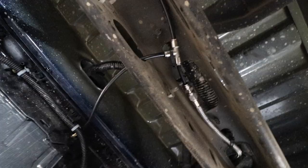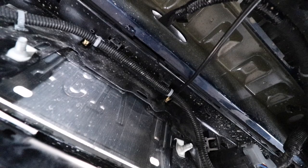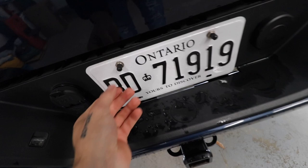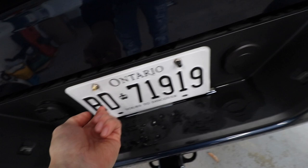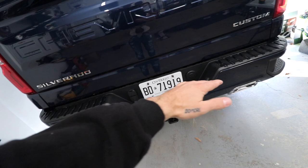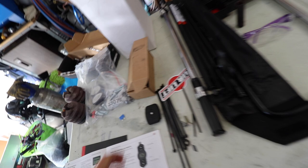So this tee right here connects the driver's side and the passenger side braided lines, and then the little tee part that shoots off the top goes straight up to the management. They give you two tees — what I ended up doing was running a second tee right out to the license plate. So that one goes right to the license plate hole, and this other one is just a dud that hangs out right there. The reason for that is the license plate is now held on with valve stems, which is actually super rad. This valve stem is connected to the whole system. And I ran two because I don't like things looking uneven — the second one is literally a blank hole, but they match when you look at it. I basically ran that in case anything ever happens to the management — I can still manually pump this up. If my remote's not working or something, you can still add air from right there. It's like a little fail-safe. Everything's plumbed, it's all tucked up, zip tied out of the way.